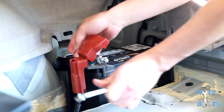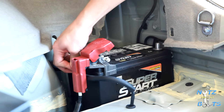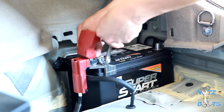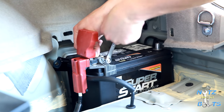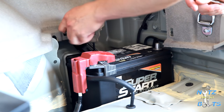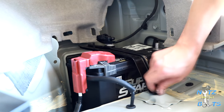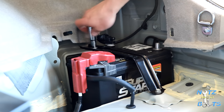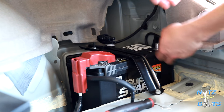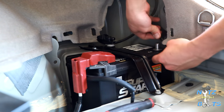Don't forget your vent — you can still pop that in after. There you go, it fits right under the positive cable just fine. Tighten that down with the 10 millimeter wrench, don't go too crazy. Snap that down and then the last thing is getting the negative hooked up and wedged in there.